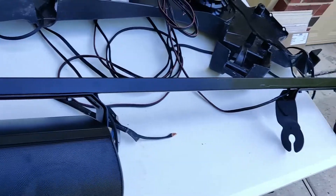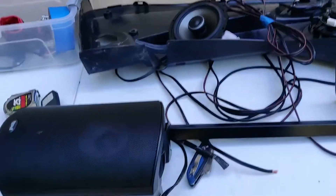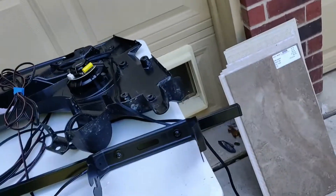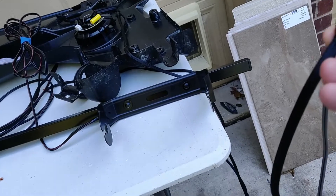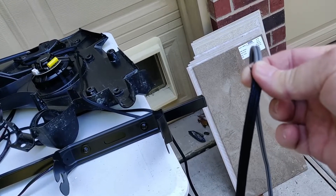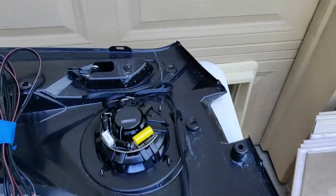Let's start off with the bar that will go across the back — it turned out pretty good — running my lines through and over and down and around. One of the things I'm doing to all my wiring ahead of time is wrapping it in PET mesh sleeve. All you do is tape the end once you're done and you've got a really secure and protected line. I do not like the plastic tube — that stuff's junk, it looks bad, sounds bad, and comes apart. This is inexpensive and you can buy it just about anywhere. So I've wrapped everything.